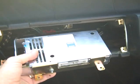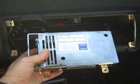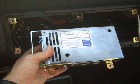that connector. Now with the connectors removed on this model, we also have a fuse at the end that's held on by a clip, and to release this, we can wiggle this down to release it. There we go, and that releases. And remove the CDM box. The dealership's also known for calling this the tuner receiver box.